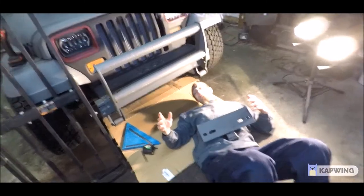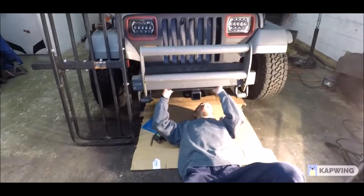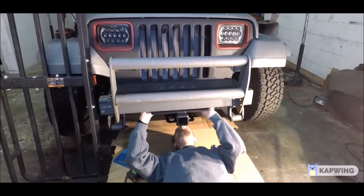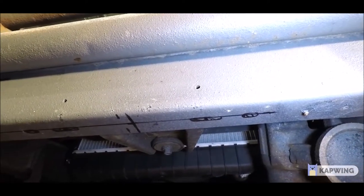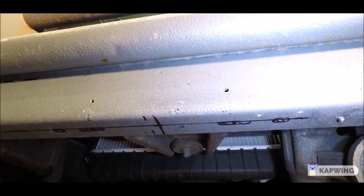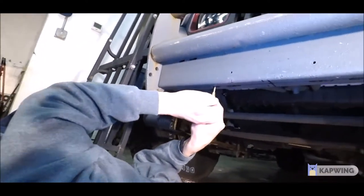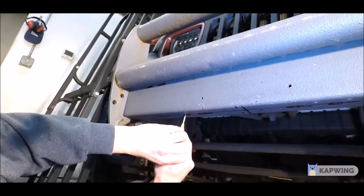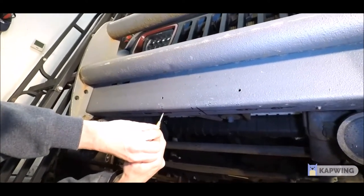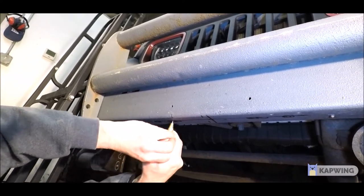The flanged nuts and bolts were about 5/8ths or so. Just take the mount to a hardware store and look around — basically, we're trying to get the largest bolt that we could fit through those holes. I actually went to a local True Value hardware store instead of a big-box retailer, and the gentleman showed me these bolts. They weren't cheap — the set was $30 — but it made the installation much simpler without needing additional washers and lock-nut washers: a cleaner, tighter fit. You can see Zach here center-punching some of the holes we had lined out with a Sharpie. What you want to do is start with a smaller bit and then work your way up to the size that you need.